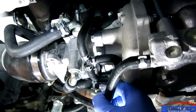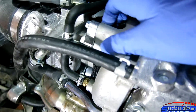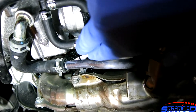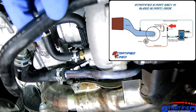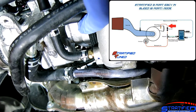Let's go over it because it's actually a neat system — it's good to understand how it runs. First, here is the compressor — the cold side of the turbocharger — which is pulling in air, compressing it, and pushing it into the engine. You can see several lines here. One line takes boost pressure directly from the compressor side and feeds it into this T-fitting right here.